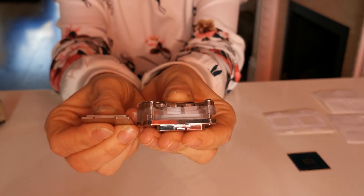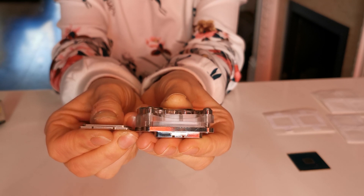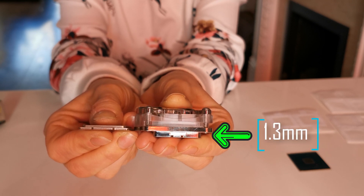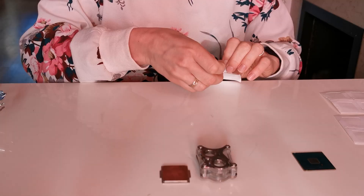Firstly, you have to compare the thickness of the wings on the IHS of your CPU and on the Encore. The Encore has an average of 1.3 mm. The IHS wing will be thicker depending on the CPU model, and you need to compensate for that thickness. That is why you need the stickers.